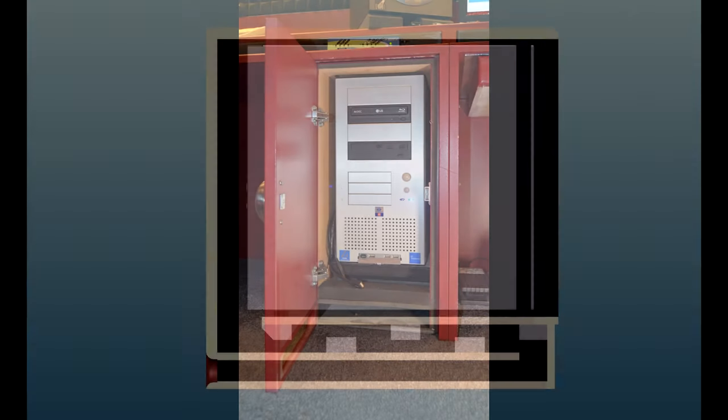Now let's take a look at a cutaway of the acoustical enclosure model. The front is at the left and the rear is at the right. Intake air enters the door opening at lower left and travels to the rear of the enclosure, and then the plenum bends 180 degrees and the air travels back to the front of the case, where it can enter the PC air intakes at the bottom of the case front panel. Sound being radiated from the PC is traveling in the opposite direction. The gray rectangles located in the upper passage of the plenum represent acoustic foam blocks that form baffles. Notice that the baffles are slightly thicker than half the height of the plenum, so there is no straight path for noise to travel. At the rear of the PC case, a vertical black band represents a foam seal on all four sides of the case to prevent exhaust air from recirculating back to the intake. There is also a foam door gasket around the perimeter of the case and a foam gasket horizontally separating the upper and lower plenum passages at the front to prevent short-circuiting of either air or noise.